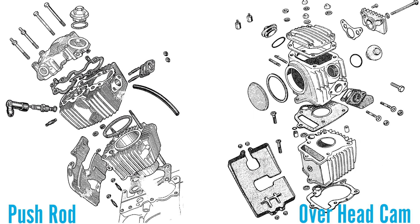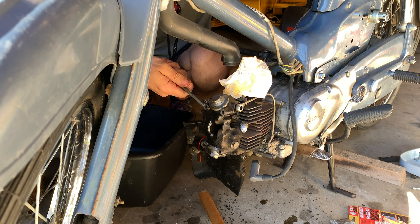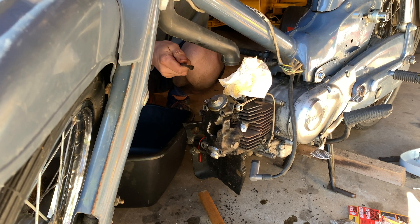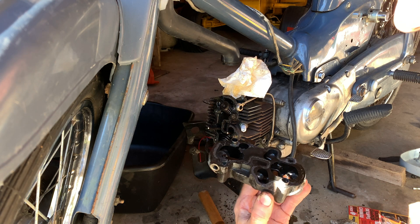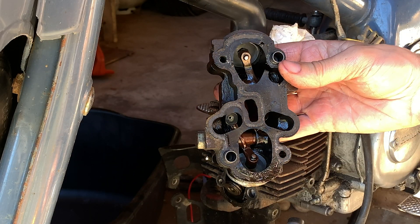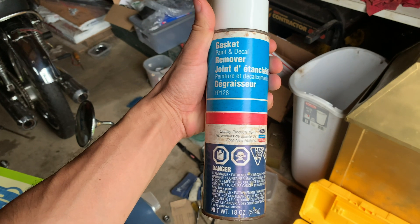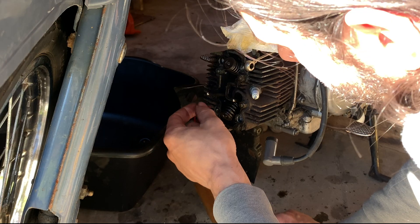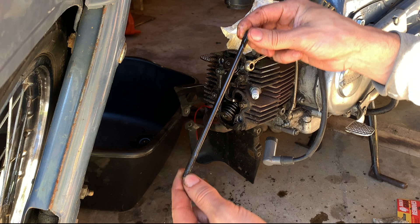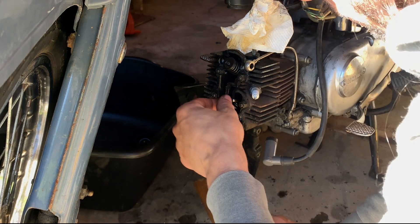Just so there's no surprises, the cam chain version is on the right for comparison — it's not everything that's in there but it's the gist. Notice there are no chains in the push rod diagrams. These are the rocker arms, and after I paint it with high temperature engine paint I'll remove the gaskets — right now they kind of act as a paint mask. Slide out the push rods; the one on the bike's right is longer.